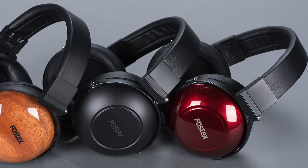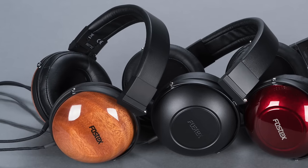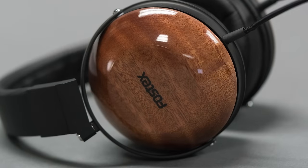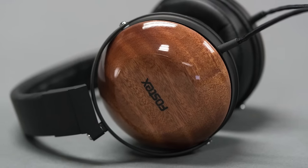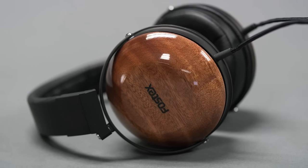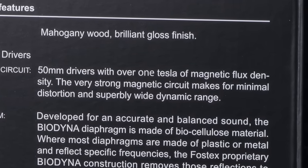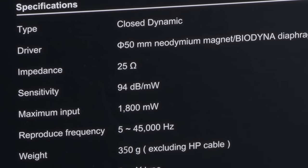As you can see here, many of its structural parts are definitely similar — identical, really — to the other TH series headphones. The build quality also looks and feels similar, which is to say very well put together, very high quality. The THX100's ear cups are made of mahogany, and while not identical to the Denon D7000's ear cups, they're still beautifully finished and gorgeous to look at. Like the TH600 and 900, the THX100 uses 50mm BioDyna biocellulose drivers and has a nominal impedance of 25 ohms. Its drivers have over one Tesla of magnetic flux density and a rated sensitivity of 94 decibels per milliwatt, which is a little less sensitive than the TH900, but still quite sensitive.